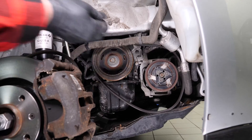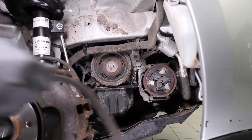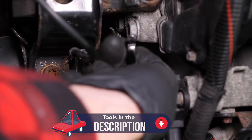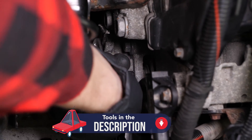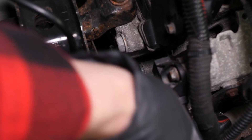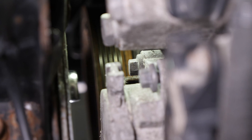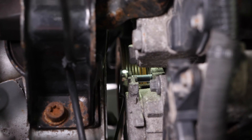When you're changing your drive belt, you also have to replace the tensioner pulley. Using a 10mm open-end spanner, unscrew the two upper tensioner retaining screws. Then, using a 10mm offset wrench, unscrew the lower retaining screw of the tensioner pulley.